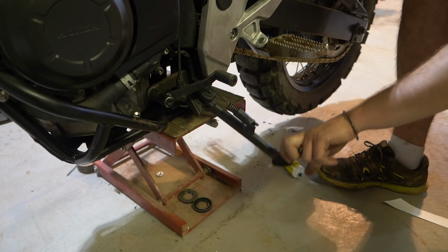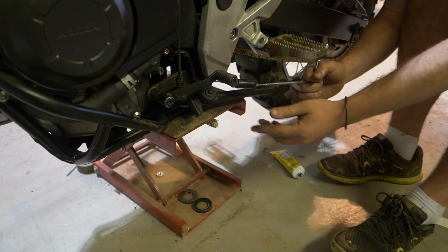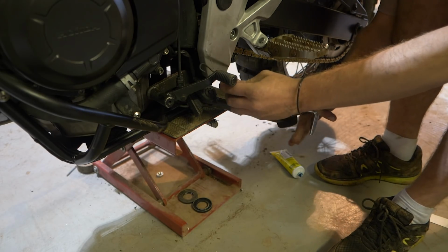Final thing, I guess, was the side stand. So we've changed the height of the bike, so you guys have got a different sized side stand. Yeah, we're expecting people also to use luggage, and there's a lot of different options of what people are going to put on the bike. So we've made an uprated side stand. That's a stronger construction than the OEM one. Like you said, it's got increased length to adjust the difference in angle because of the suspension difference.